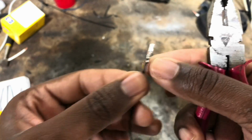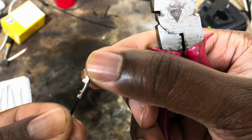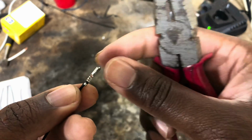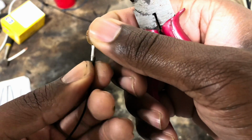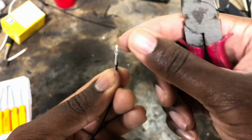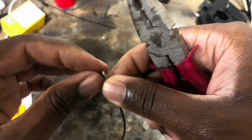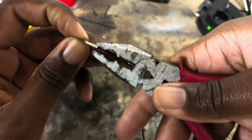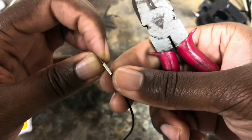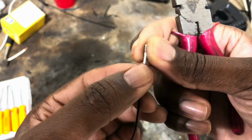And at the end, here's what you're left with. You're left with something that's clamping around the conductive material and the insulation. When you're looking at the back of it, everything is straight and able to slide back into that plastic connector. And if you need to tweak it just a little bit, it's pretty robust, so you can do so.